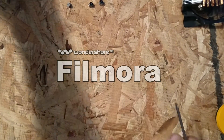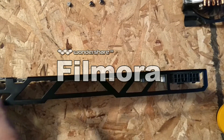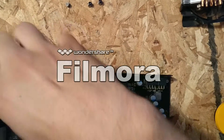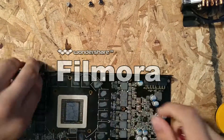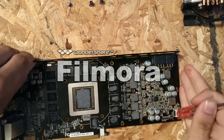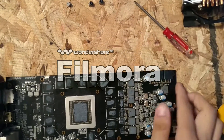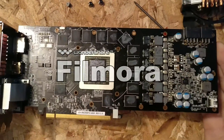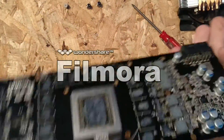Next up, we're going to take off the top piece. Like I said, there are four screws holding it on — it's just this little bracket. You start from left to right. The screw hole to the left was above the board while the other three were beneath it, so you have to slide that off. If you pay attention and know what you're doing, you shouldn't damage your card.